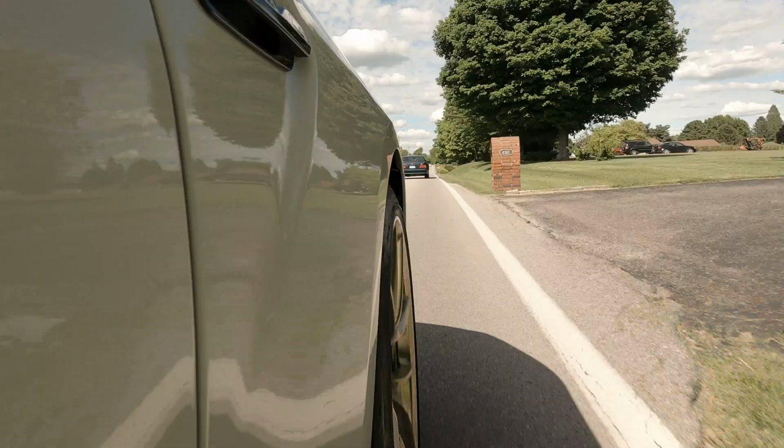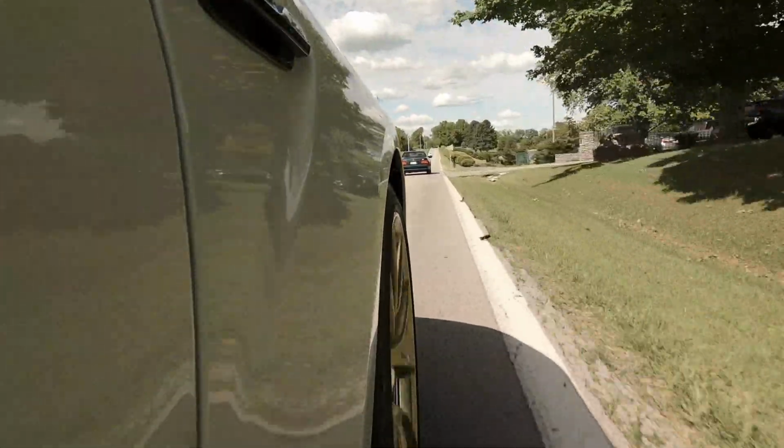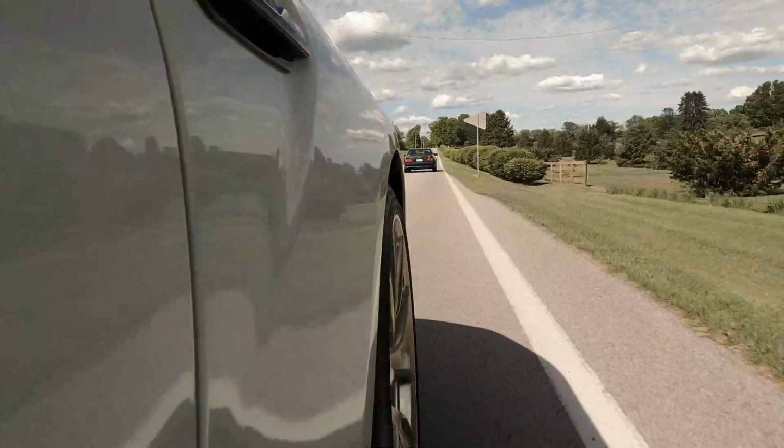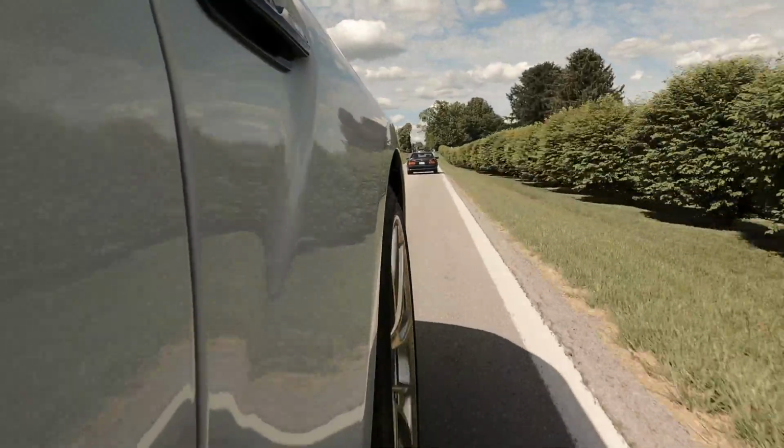The tires. So the tires on this car are the Michelin Pilot Super Sports, which are the same tires I had on my 997 GT3, because back then Cup 2s weren't a thing. So I actually think these are probably the better tire for all around, just driving around. I think they're going to be a little bit more comfortable. Their sidewall's a little bit more forgiving, so it's a little softer. And also, they will channel rain better than a Cup 2.